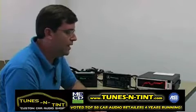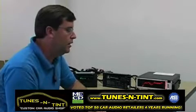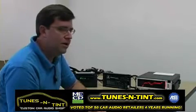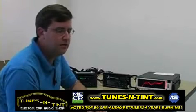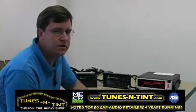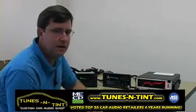Another way to do it is with an active preamp that has the ability to sum its outputs because the inputs and outputs are isolated — those products can work very well. JL Audio sells a product called the Clean Sweep CLSSI, which is dedicated and designed purely as a signal summing interface. Because it's so targeted at what it does, it has features that make it really well suited for this application and easy to set up for the installer in a minimum amount of time.